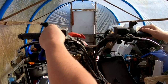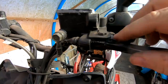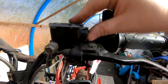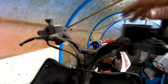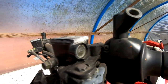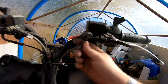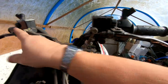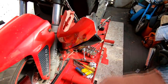Right, there we go — they do live underneath there and it looks like they have been leaking, or one of them has. It looks like there's been some wrinkling there where the brake fluid has leaked out maybe — they seem to be dry though, so perhaps they're not leaking. The tops need painting and probably cleaning as well; the main body seems to be okay, but I can dismantle these lids, have a look inside, and see if they're a bit gungy. The fluid looks pretty clean in there but I will drain all the fluid out. The yokes and everything seem to be in good order and these are Goodridge type hoses, so I'm happy with that. I'll just remove the caps so all the fluid can be drained out, and I'll get these calipers off.